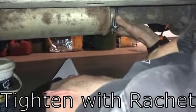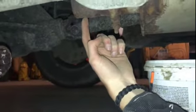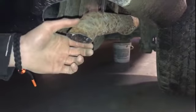How do you like that pipe? Looky here, I may have found it. So right here, end of the muffler — we got a 2¼ ID, and this is a 2¼ OD. So I bought this nifty piece, it's a 2¼ ID OD. So this side is going to fit over here and yet still penetrate — I repeat, penetrate — this pipe. It's a really tight fit. I was having a hard time laying down underneath there trying to slide this pipe over the 2¼ ID OD.